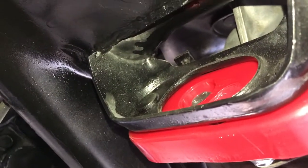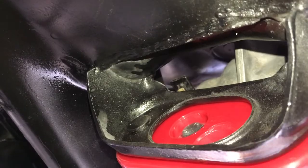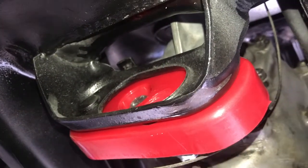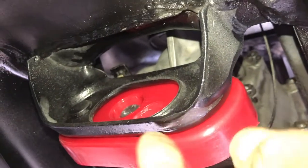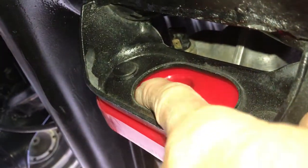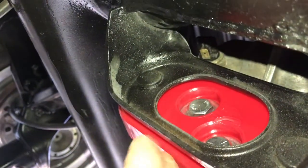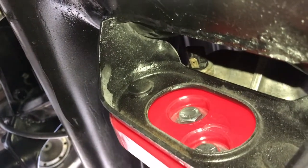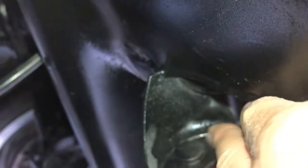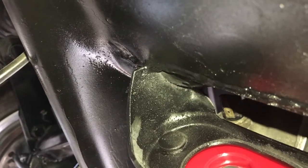I am right under Sunny the Super Beetle. This is the front mount receiver for the transmission. The problem I have is that, even though they said this is an aftermarket upgrade, you can see you don't have that alignment piece with the rubbery portion that helps alignment and absorbs vibration. Those two bolts there are what I was showing earlier in the Frankenstein demonstration.